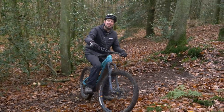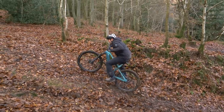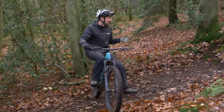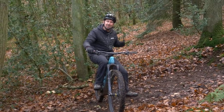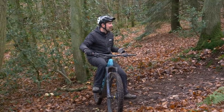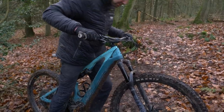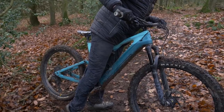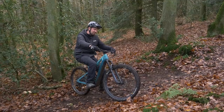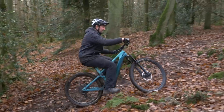Your e-mountain bike is a pretty capable climbing tool, but if you make a bad line choice or get a bit of wheel spin, you're going to come to a grinding halt. If you want to carry on attacking the hill and swap to an easier gear, there's a risk of snapping chains or a horrible gear-crunching sound from your cassette. This tip is similar to the stationary gear change but will save you from that. Stop sideways on the hill, select walk mode, hold the front brake, pivot the bike up onto the front wheel, get walk mode engaged, then select your easiest gear — first gear. Once the back wheel touches down, engage boost mode. You're in your easiest gear, boost mode engaged — focus on your line, pedal away gently, and be glad of not snapping your chain.